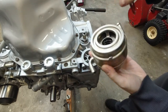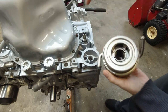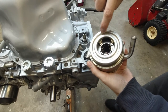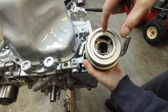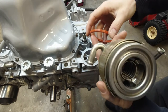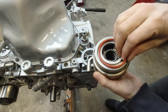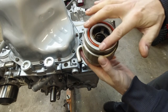So this is the oil cooler. When you look inside the walls, this part goes to the block. This outside wall is kind of tapered — it's wider on the edge and the opening gets a tiny bit smaller as you go in. Same thing goes for the seal: it's slightly thinner on this side than on this side, so that's going to go inside first. I'm going to apply a tiny bit of oil.